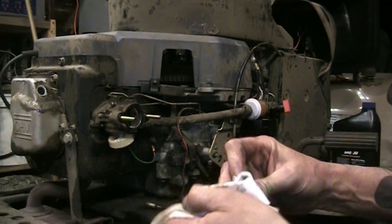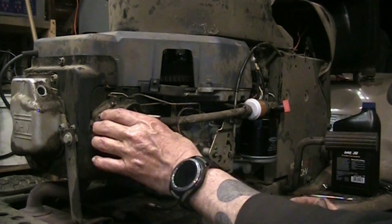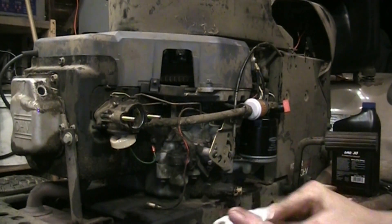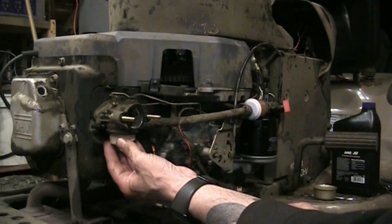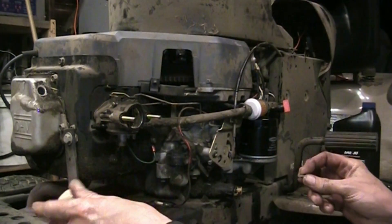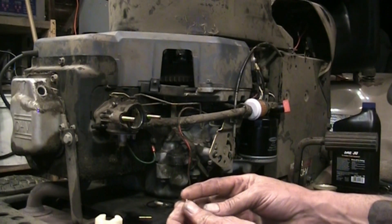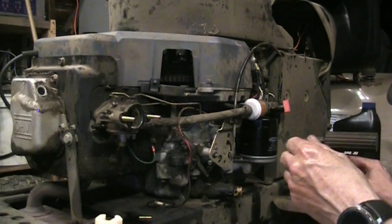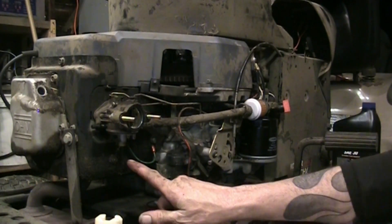I don't know where the debris is coming from because this was a problem the last time I had this carb bowl off. I'm not going to pull the carb off completely. Wiping my hands on the rag — pull the float pin out, pin is out, needle is out, gasket fell off. Look at that needle — float's not sunk, no fuel inside the float. It's got a rubber tip needle which means it's got a metal seat. A little bit of black on there but nothing — dirty but not damaged, bent, or mangled.